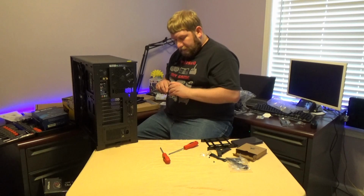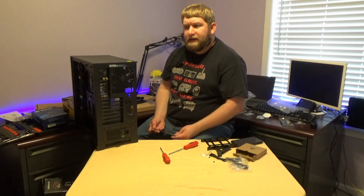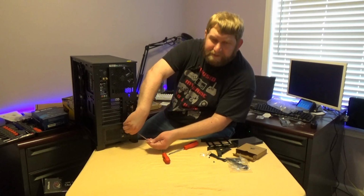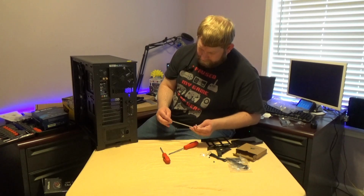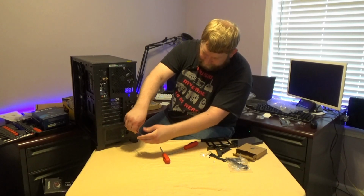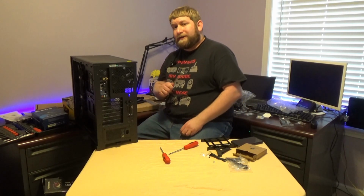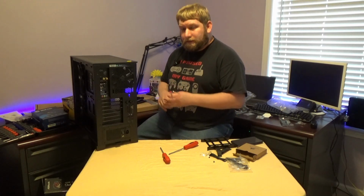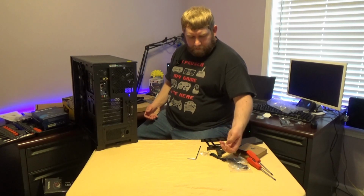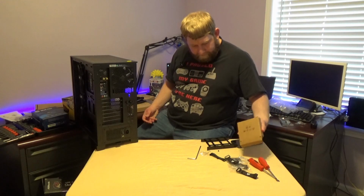And even though I have all 4 corners, again, there is a 5th one that is there for some reason. Now, what makes the most sense to me, guys, is that you're potentially grounding something else to this, and then you would put a ring terminal. If you ever see a green wire hanging off of something and screwed in somewhere, that's them making sure there is a ground wire going from a ground that they know works properly and is connected very well, to something that either isn't or they're not very sure about. Normally it is, because they don't do a lot of guesswork in engineering electronics on this type of stuff. That is all tried and true, figured out, and a lot of times it is through trial and error, and sometimes very expensive errors.